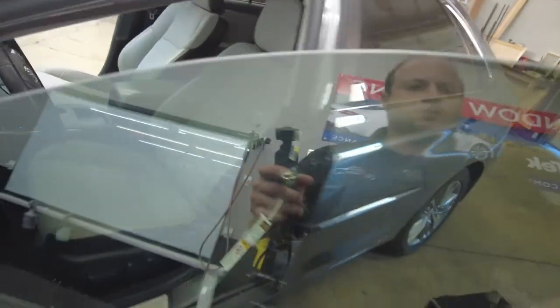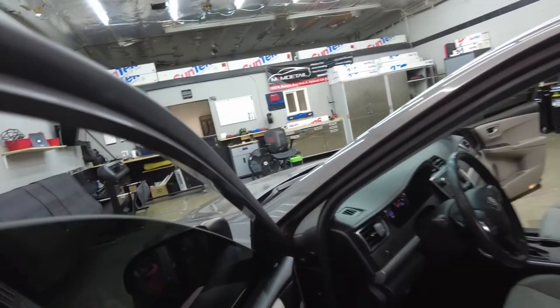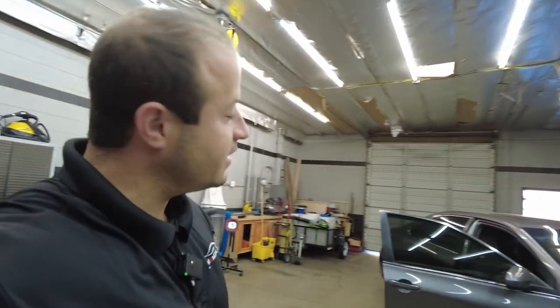And this is all due to that film catching, guys. So see how that little thing just made everything that much more work. Bam. Looking good. Roll this window up. All right, guys. So that's pretty much it for the video. Sorry about that little hiccup, but at least I was able to show you guys how to troubleshoot if the tint did get caught in the top gasket. We didn't get any creases, so that was cool. Just had to burn some debris out, some little air out.